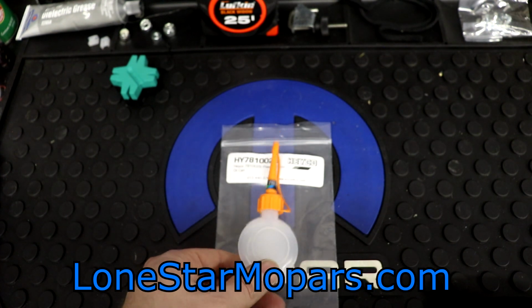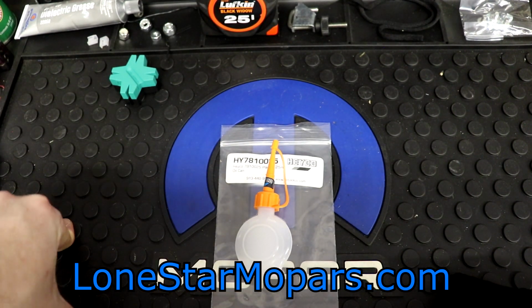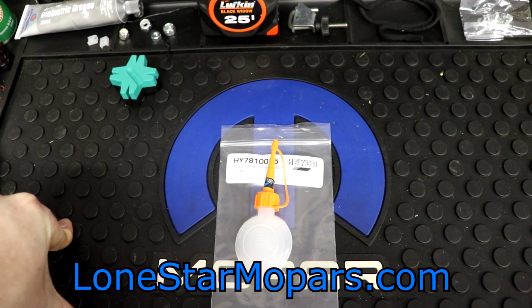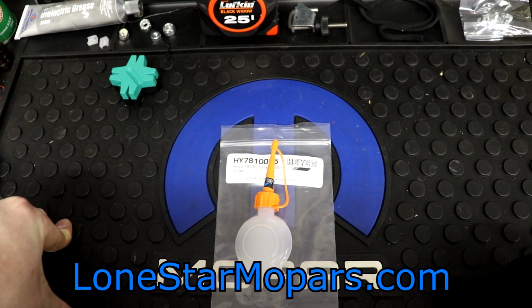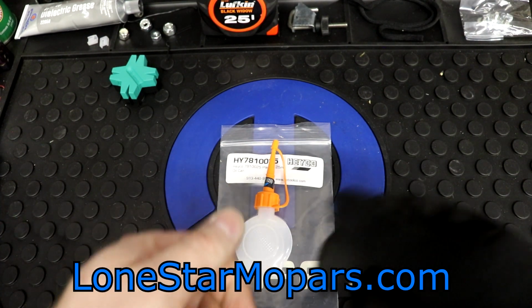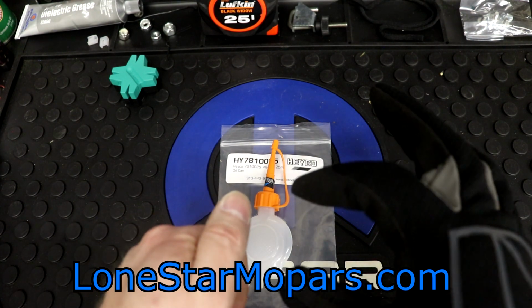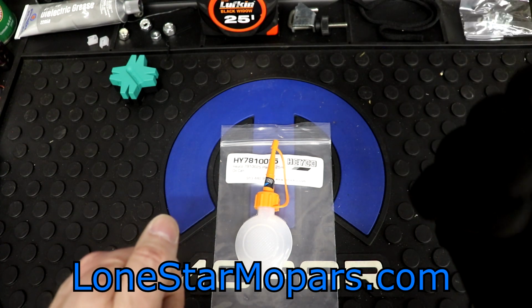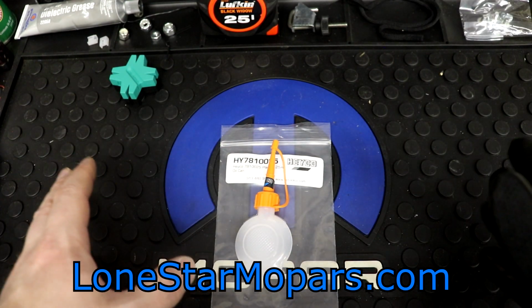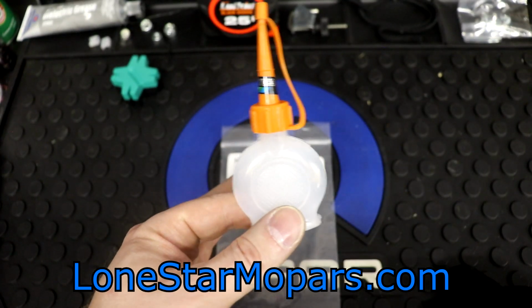And what it was, I actually don't have the can here, for the first time in an eternity, but it's over on another workbench. It was for this case going to be tested with the hose assembly lube, right? So like AN, PTFE stuff, you always want to oil the threads. The bottles have the flip top and they dump some, but they dump a lot. It's either nothing's coming out and so you give it a little squeeze, and then everything comes out. I got tired of that, so I'm going to pour some into here, and this will be what I utilize.